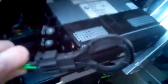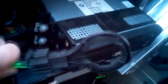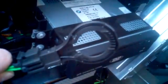This is the speech button that you have in the steering wheel. There are a couple of things you could do: you'd have to replace the module and have it programmed at your dealer. In some cases, depending on the type of module, you can actually leave this fiber optic jumper installed, which will correct the problem temporarily unless you have another issue where a module replacement and programming is required.